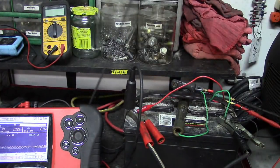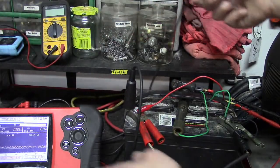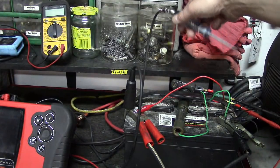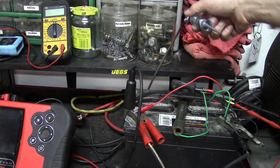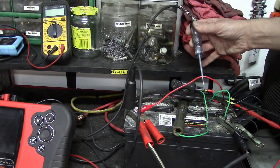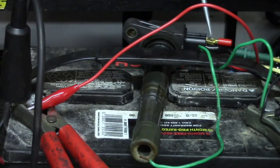I'm going to take my test light and give it a low amperage feed in. I've also got an oscilloscope here, but that's for another video on my channel where we'll go over this in much more detail and show the waveform to verify the primary and secondary are working — we'll do that later. So just going to put in my input signal and we can see and hear the spark. Let's make sure that's showing up on the camera — okay, you can see it's definitely working.